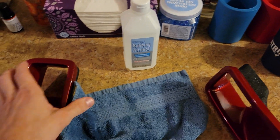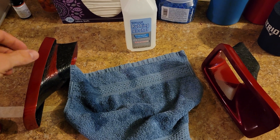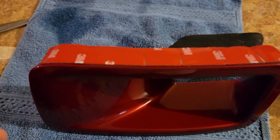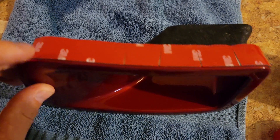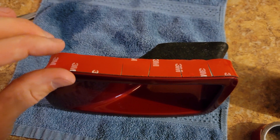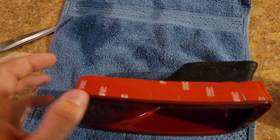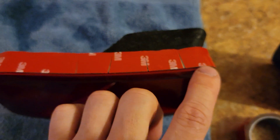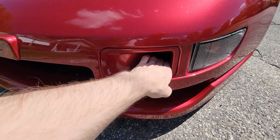I'll lay down the 3M tape all around every edge. There's a trick here: the ducts fit well but aren't super tight, so in some spots you may need more than one strip of 3M. Also, don't put the tape right on the edge — if you put tape at the edge and apply pressure, the tape kind of expands out, like pushing on jelly. Leave about a fingernail's width from the edge so when you press it in, it sits flush and you won't see the tape.